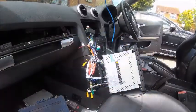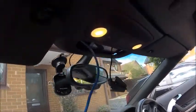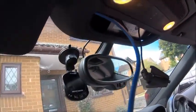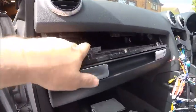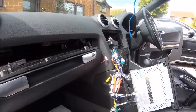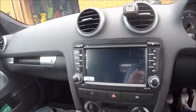That escalated quickly. I'm trying to put the GPS antenna up near the windscreen — I don't really want it sitting on top of the dash looking ugly. I'm feeding the wire down the A-pillar behind the glove box and straight into the stereo — job done, nice and tidy. All wired up and all in place.